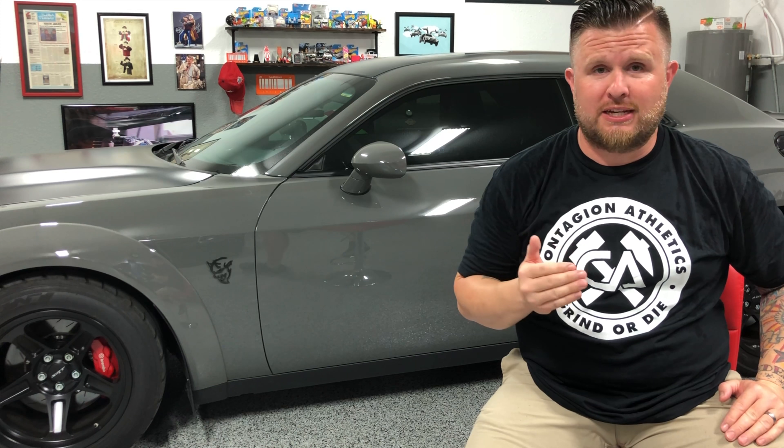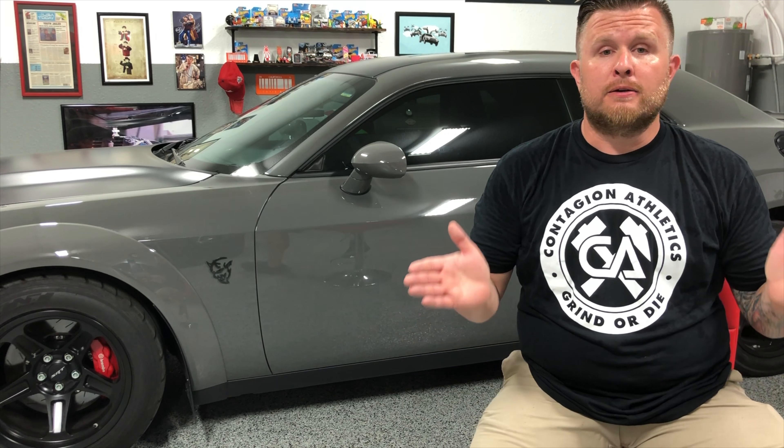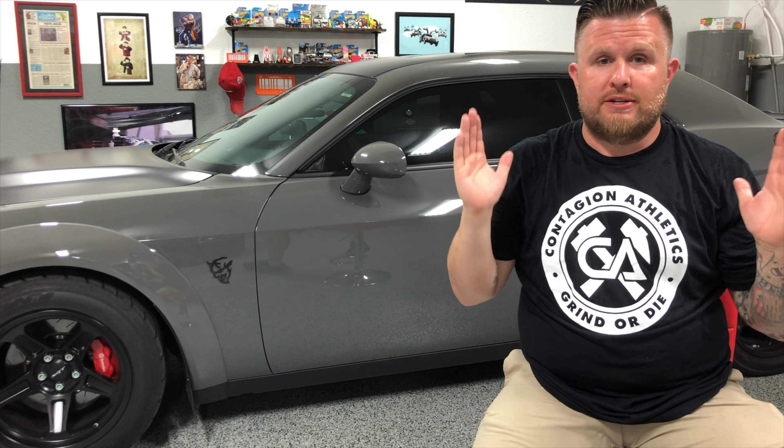You're not getting the full benefit of the width of the tire. In order to get the complete contact patch, you're going to have to step up to a wider wheel. On my Hellcat, I ran a replica wheel which is 20x10.5, and that safely allowed the use of a 315-wide tire. I ran a 315-35-20 Nitto NT05R. The contact area of that on a 10.5-inch wheel — you're not putting any pull on that bead, so you're getting the full contact area of that tire hitting the ground.